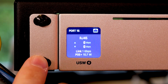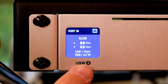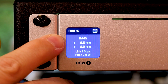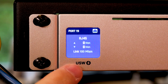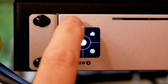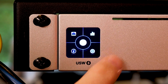Port 16 shows 8.5 watts PoE — that's my CloudKey Gen 2 Plus, pulling anywhere between 7 to 11.5 watts with a decent amount of upload traffic from all the cameras writing to it — 9.2 megabits of upload. One port without PoE just shows no PoE at the bottom. If something is plugged into a PoE port but not using PoE, it'll say PoE Plus without a wattage next to it, compared to one actively drawing power which shows the wattage.